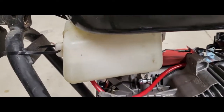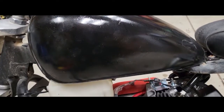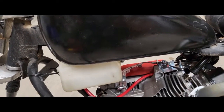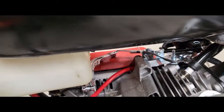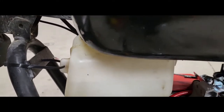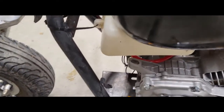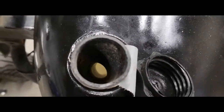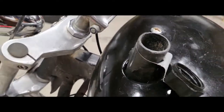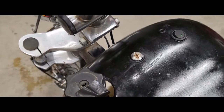This gas tank is off my old pit bike so there's gas in it right now. I chose this one because when I put the other gas tank in with a tube, it didn't vacuum out - I don't think there's a vacuum on this carburetor, so it has to be gravity fed. What I did is I ran a fuel line right into the carb and right up to the gravity-fed line, stuck a zip tie to hold it in place underneath the bike, then took my shop vac tube, cleaned it out, and ran it from the top. There's no cap - it's a tube that runs all the way up, sticks out, and you take the cap off and look right into the gas tank. Kind of clever, kind of weird, but it works - you get a little funnel, pour gas in, goes right into the tank, gravity fed right into the carburetor. Done. Problem solved.